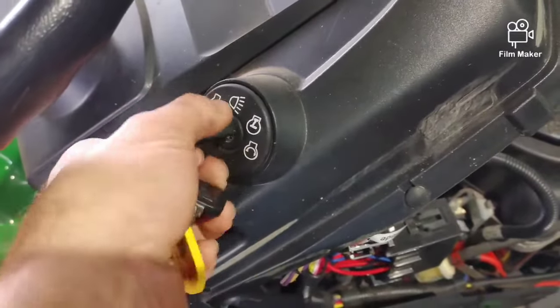Once it did fail, I knew exactly what was going on. In the clip, you'll see I turn the key twice and it cranks, then the third time I turn the key and nothing happens. What I'm going to do in the video is bypass the solenoid to start it up and show you guys how to do that — I just take a screwdriver to bypass the solenoid by touching the two posts on the solenoid to go from the battery straight to the starter.